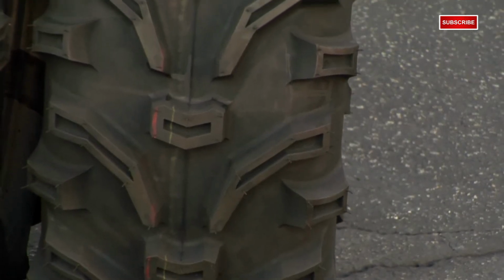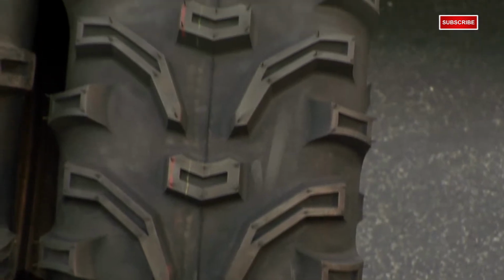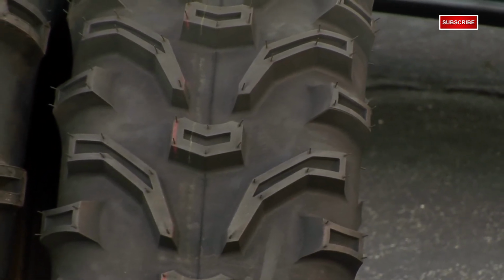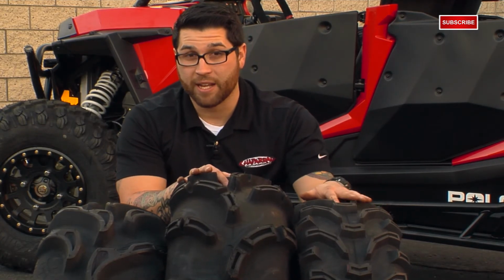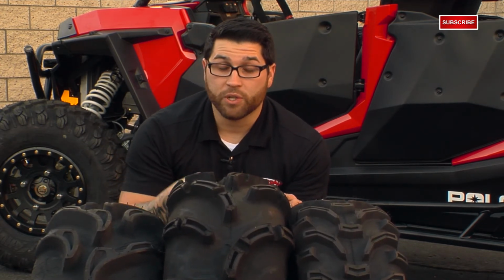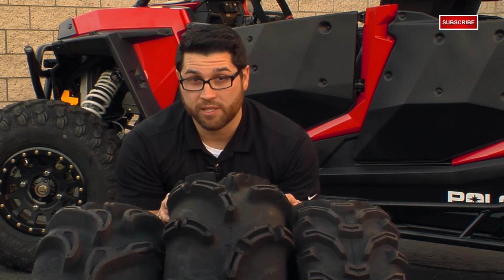These are the Kenda Bear Claws and are popular here because they can handle lighter mud pits but are still capable enough to ride on normal surfaces like trails and even harder pack stuff and the occasional sand pit. These have a 6-ply casing which keeps them light, but they're also available in the HTR model, which is an 8-ply for extra puncture resistance.